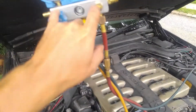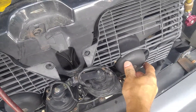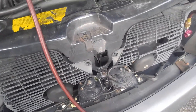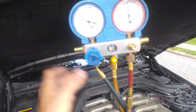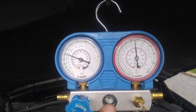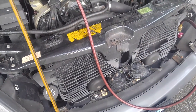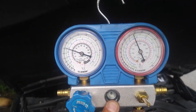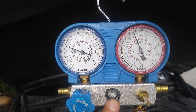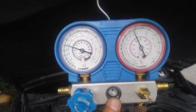The electric fans aren't actually working right now — it's just because my mechanical fan is so strong it draws so much air that it actually makes the electric fan blades spin. But as you can see the high pressure is creeping up, and finally at 250 psi the electric fans kicked in at low speed. And our high pressure is now lowering down — so about 250 psi is when the electric fans kick in.